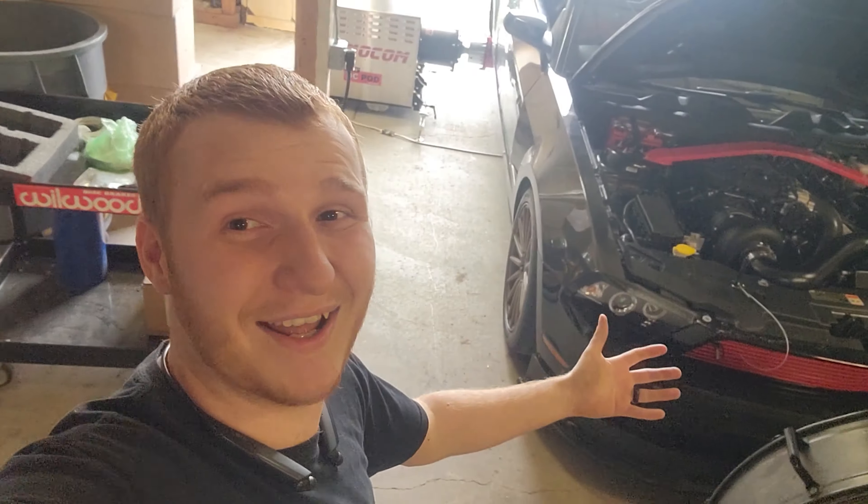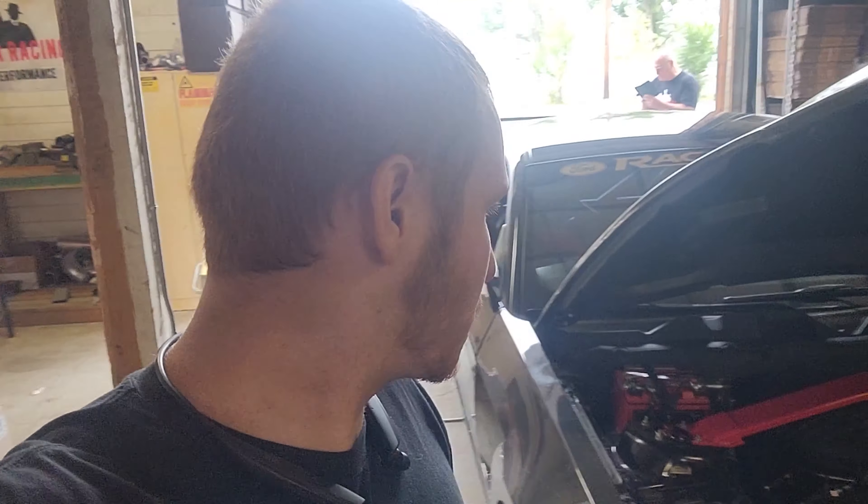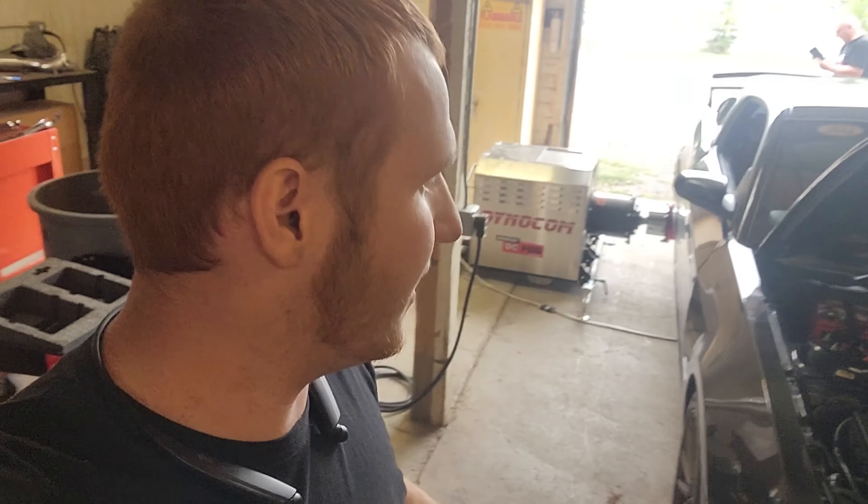What's up everybody? It's Cody from AutoMafia Racing. We are back with a dyno. Today we have a 2011 to 2014 3.7 Mustang here with a P1X with a 340 pulley, the stock crank pulley — not ours — so it is slipping, but it's still going to make some great power. We've already tested on the street a little bit, addressed a drivability issue, got that figured out. Now we're here to make some power pulls.